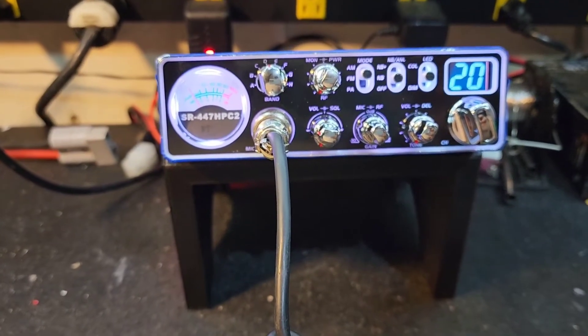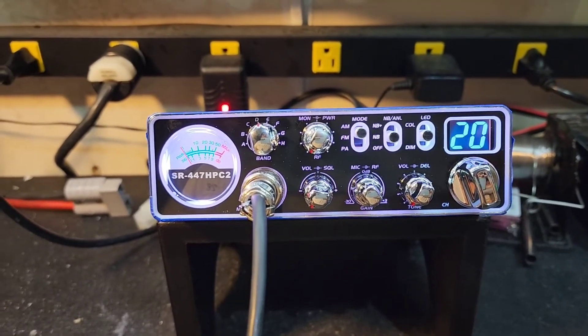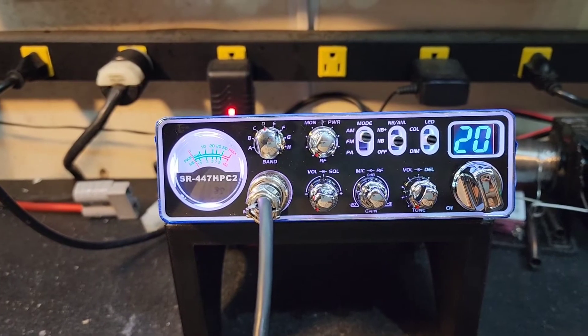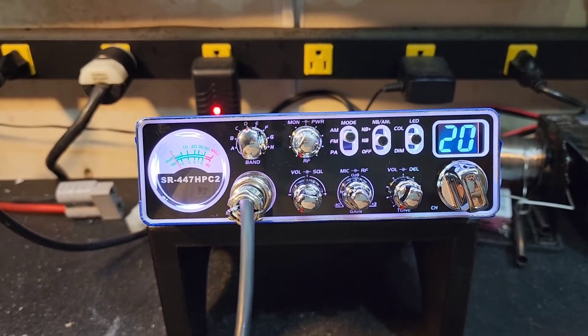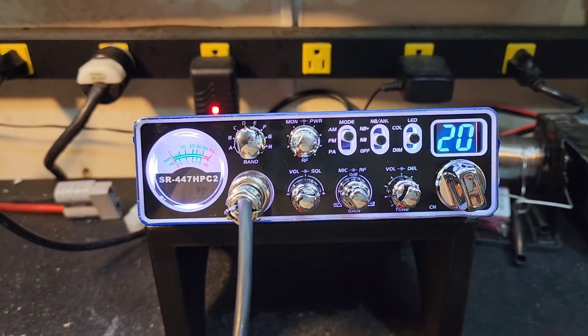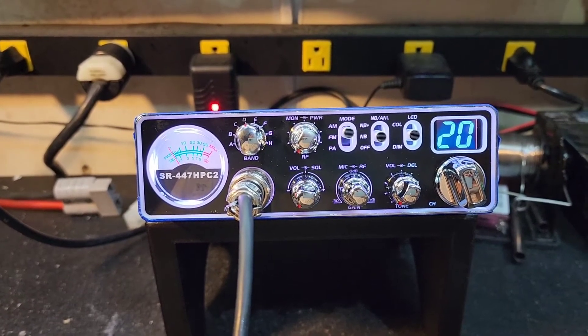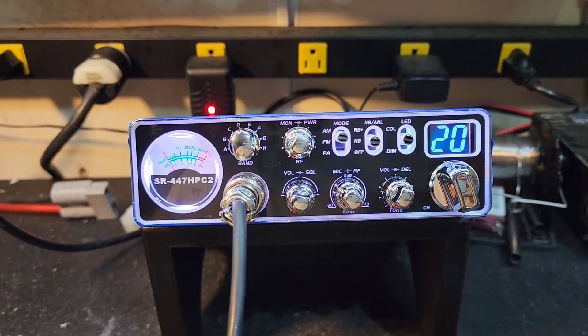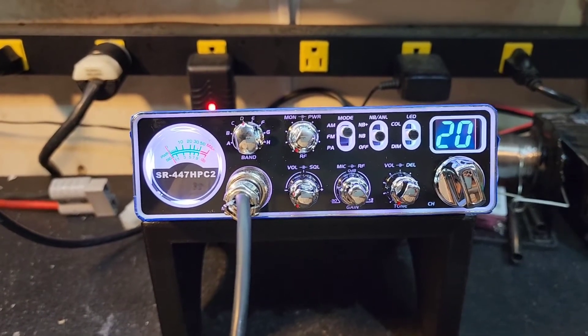It'll stay happy if you're at 1.5 or less. We got the Wilson 500 Magnum antenna coming to you for that low profile use. It's very possible you'll need to trim the stinger some to get your SWR right. If your SWR is lower on channel 1 than 40, you need to shorten your whip — once you bottom it out, if it's still lower on 1 than 40, just shorten your whip up some more. Paul, give me a call if you have any questions.